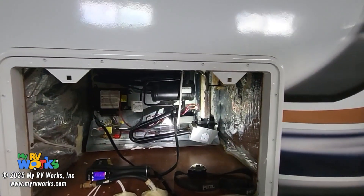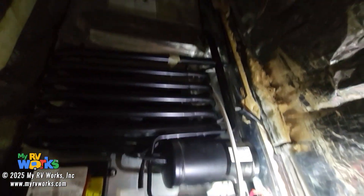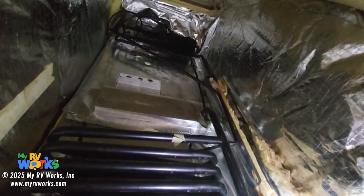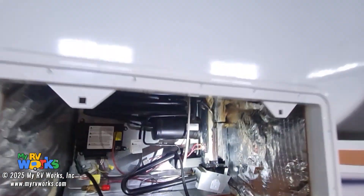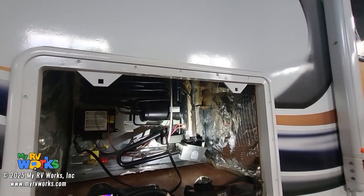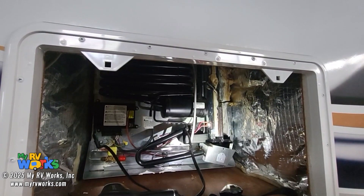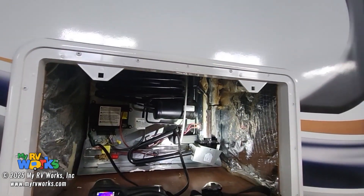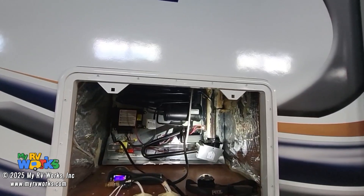To fix it right, you've got to swap out your cooling unit. There's no point in swapping out your entire refrigerator — the refrigerator itself is fine, it's just the metal tubes that you get to swap out. A couple hundred bucks for a cooling unit, and an operation like this might be about four hours or so. So if this was helpful, thumb it up, share it with your friends, subscribe to our channel. We've got a lot of stuff over on Patreon as well. I wish you good luck in troubleshooting your refrigerator. This is Darren signing off — I'll see you in the next video.